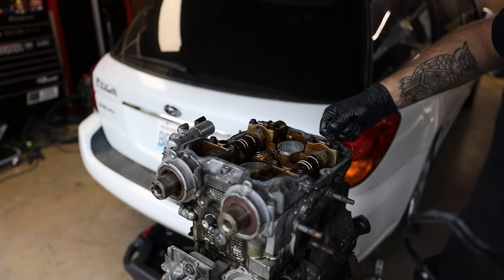All right, how is our fresh STI? It's totally refreshed at this point, so it better be good. I'm gonna prime the fuel system a couple times, just to double check. I got that defrost going. While it's doing this, make sure you're checking for leaks. It sounds really good. It sounds very smooth. I'm gonna let it idle and we'll get all the coolant burped. I'll take this thing around the block and we'll see how she drives. Assuming everything is good, we'll let the customer come pick it up.